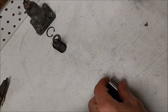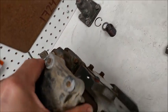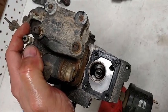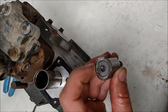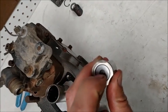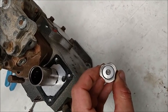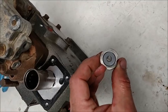You can just turn this right upside down to knock the button out. You can kind of see through the camera what's down in there — that center right there is where your fuel actually comes out. It presses against the button, and look — there's another spring behind the button. What you're changing when you change the button is the size of the hole in the middle of the button. I don't know for certain if the numbers on the buttons refer to a CC-type volume, but there is a volume there, and by changing that volume that's how you change the pressure.